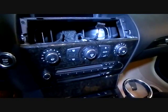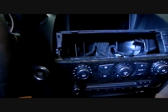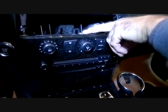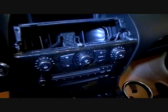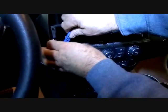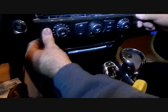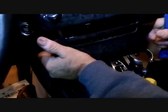Next, there are two screws that need to be removed — one on the right side going inward and one on the left side, also going inward. Once these two screws are removed, use the pry bar to pry the right side and then the left side of the front panel from the dash. This will pull forward once all the clips are released, giving you access to the connectors on the back of the panel.